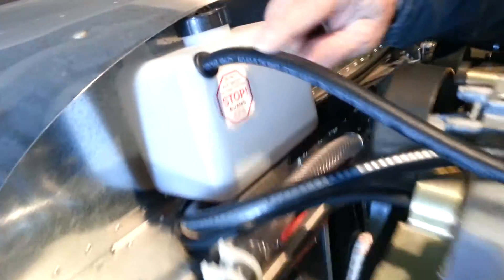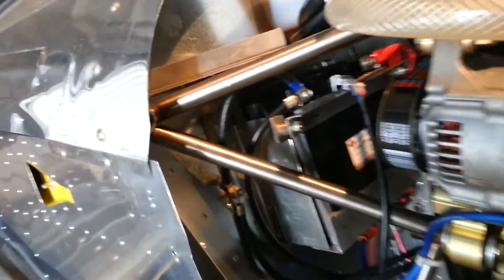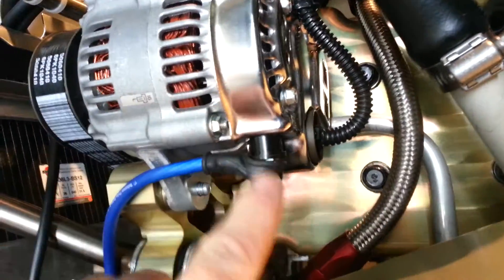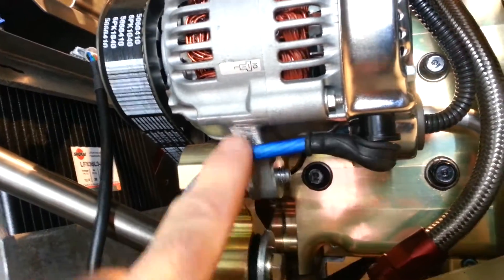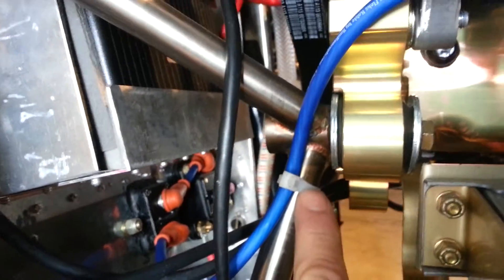We had a little bit on that top hose — we'll get that taken care of. This is a beautiful installation with excellent wiring. A couple of minor things: make sure we have clamps that hold the cables after they leave the terminals, particularly cables that go to the engine, since the engine vibrates differently than the airframe. Same here with the alternator — nicely done with a boot and protected — but we want to secure the cable to the engine before it leaves the front of the engine, not to the other side of the rubber mount, because the two sides vibrate at different frequencies.